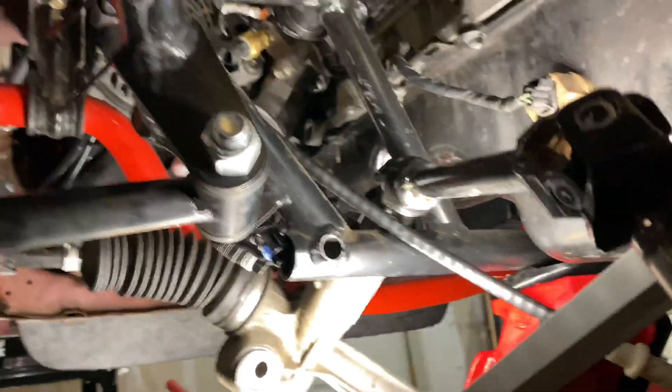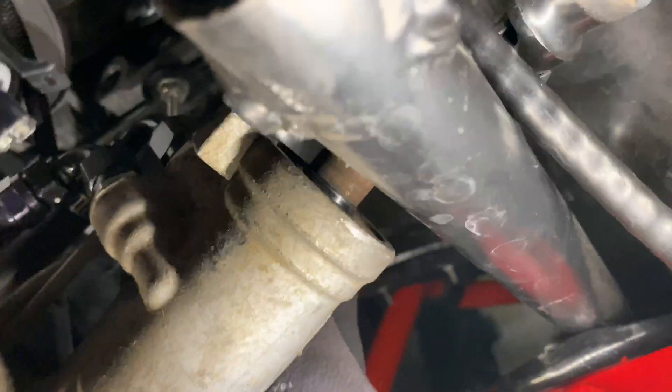So what I'm gonna do is pull this header off — I'll be able to pull it off — and then probably just let the motor hang and see if I can get the transmission out. I got my transmission jack back from my buddy. It's looking like I might be able to do it. I'm gonna pull the header off, and if I have to sag the motor down a bit — maybe a couple inches — to get the transmission out, it's good that I took the steering rack off. I'll be able to get maybe three or four inches of clearance to lower the motor.